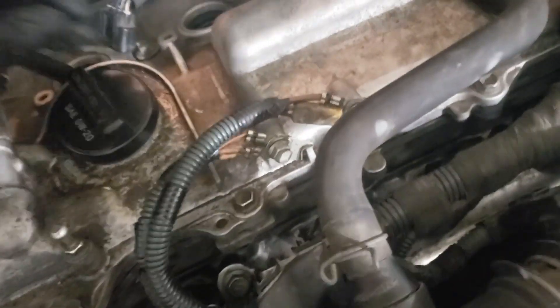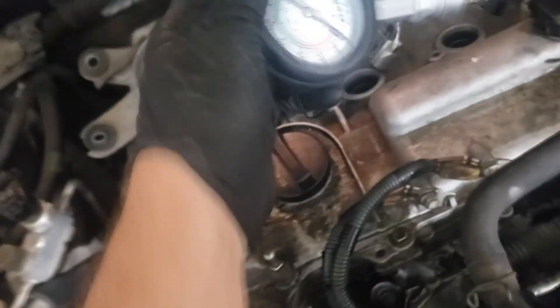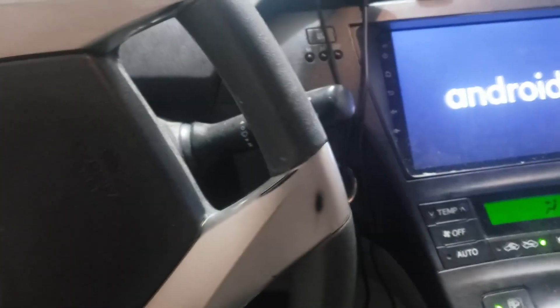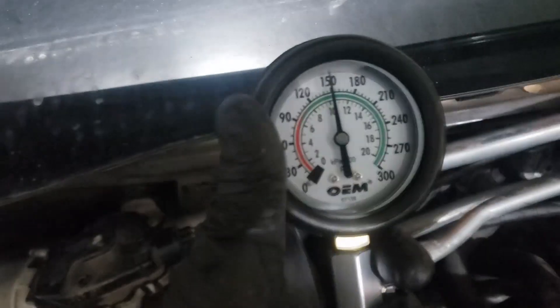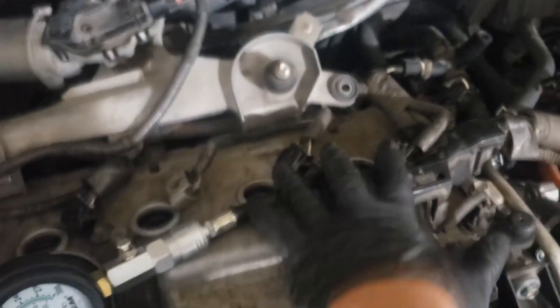Now I'm going to take this out and move it so I can show you that the numbers are different. I got another one — I pressed this to reset. I got this one from AutoZone; you can rent one and return it back the same day or the next day. Start the car up. It doesn't really matter if you leave it on too long — it's just draining the battery. Then just turn it back off. For a regular car with a starter, you don't want to leave it too long, but since it's a Prius, the electric motor starter could run forever, really. This one gets 150 psi, and the other two — number two gets around 100 and number one gets around 110. But these two good cylinders are relatively the same, so I know these ones are good and the other ones are the bad ones.